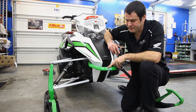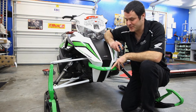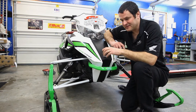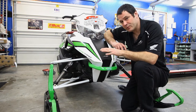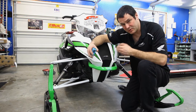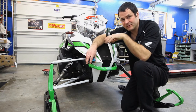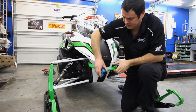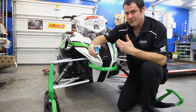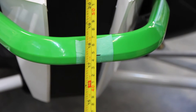Up front here we've put a piece of green tape with a sharpie line so I didn't draw on this brand new snowmobile. Then we're going to push on the bumper. The snowmobile right now is on the concrete floor so we've got a repeatable reference number. If it's up on dollies that allows the front to scrub a little bit better, but depending on where the dolly is placed in the back it'll have a dramatic effect on the loading, so we've got it right on the concrete floor. We give it a couple of pushes to allow the carbides to settle so that we have a repeatable reference number, and then we measure straight down to the floor.